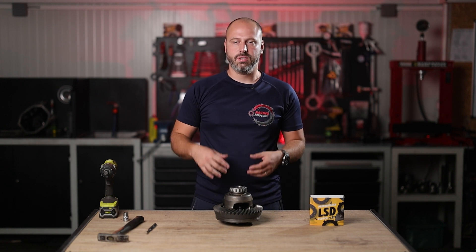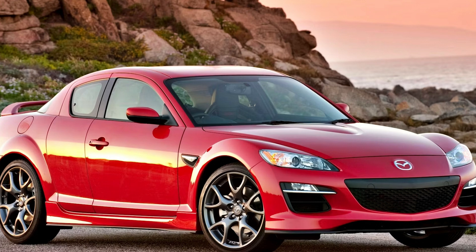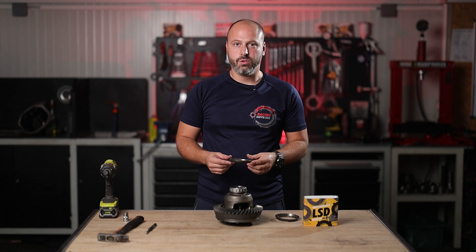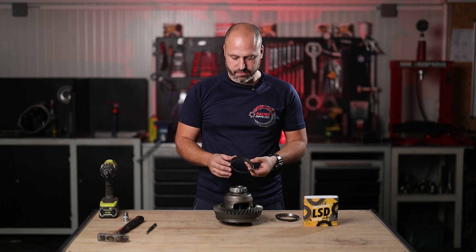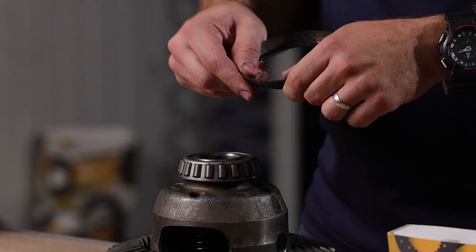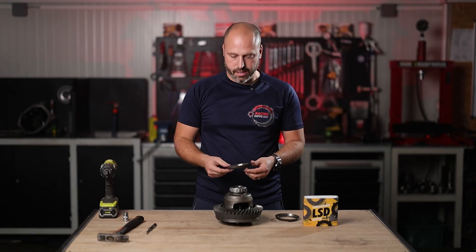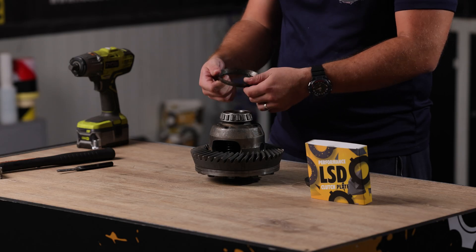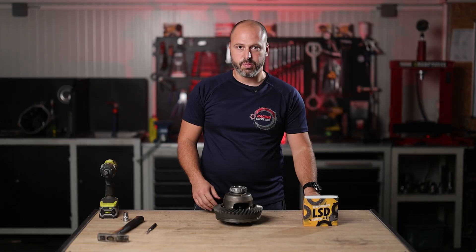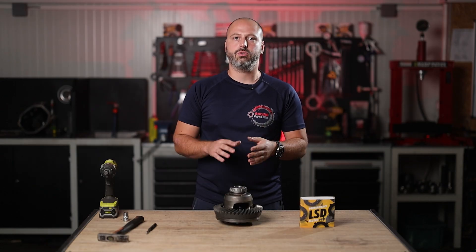Today in this video we're going to talk about how to solve the common failure of the Mazda RX8 limited slip differential using Racing Diffs parts. The first thing that will fail in this factory type limited slip differential is the friction cones. They are prone to breaking from the pressure and throttle, and if you're a drift-oriented driver you will most likely break these friction cones and lose the locking percentage of your differential. We at Racing Diffs formed a reparation set to install in the factory LSD unit to solve this problem once and for all.